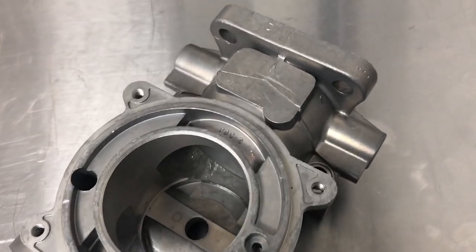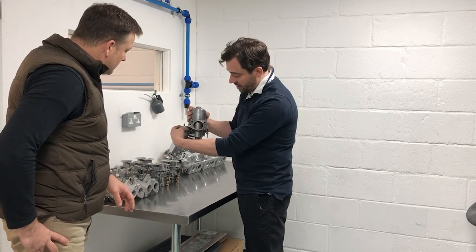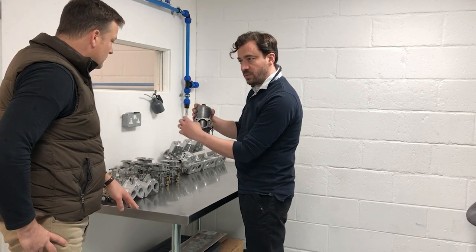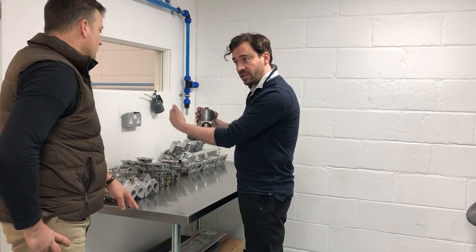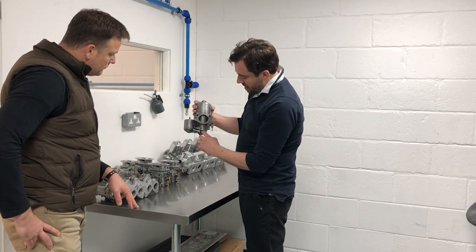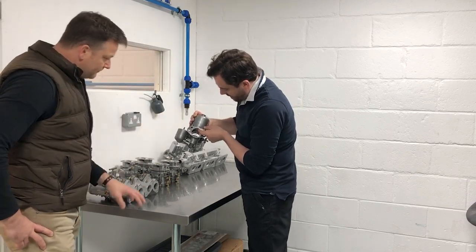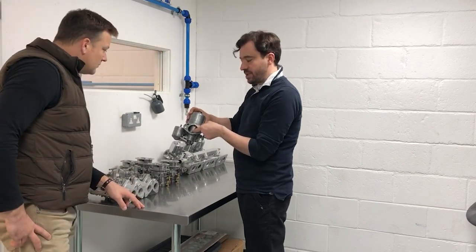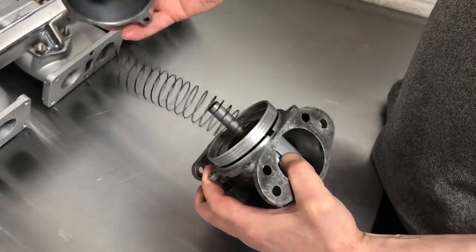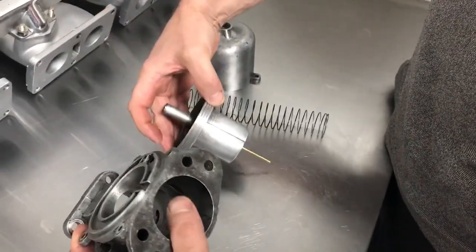That meters the fuel into the airstream. The fuel comes in under pump pressure into here, but there's a needle and seat which, once it's full, will shut off and hold back the pressure so that this is not a pressurised vessel. That fuel comes in here and is pulled up by the airflow as it's sucked through that hole as it's revealed. You've got the needle - the needle is tapered. So when the piston's at the bottom, the needle is quite fat and closes most of the orifice. Then once it's up at the top, the needle is much thinner and reveals much more of that orifice, allowing the fuel through. It sits on top of the bridge, which essentially creates a venturi - a narrowing of the passage which accelerates the air, creates that low pressure, and pulls the fuel into the airflow and mixes it as it comes through the butterfly.